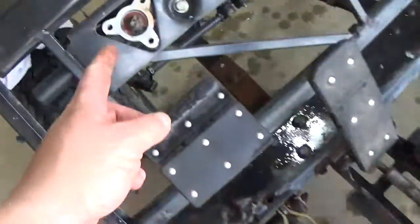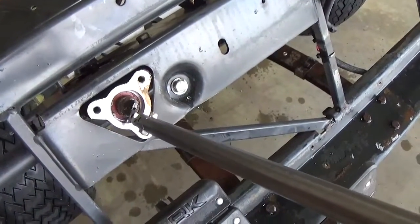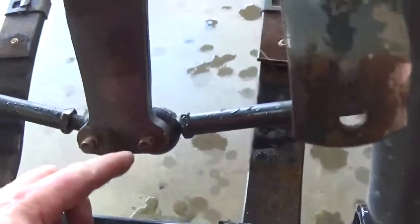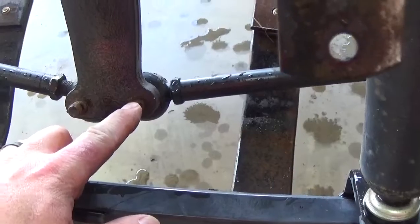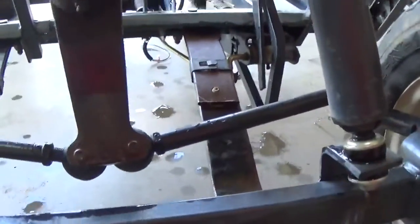So there are three bolts around the column. Down inside there's a separate shaft, which is actually your steering shaft — that one is held with a little pinch bolt. This outer sleeve is basically decoration. Then down underneath, one, two, three bolts should drop the whole assembly out. We've got our tie rod ends. Now, before you go whaling on these and mess your threads up to where you can't get your nut back on — if you don't have a pickle fork handy, what you can do is hit on the side where that bolt goes through, and that'll kind of shock it loose.